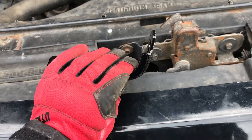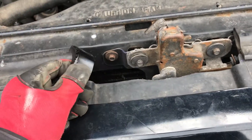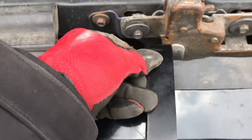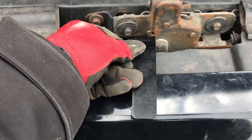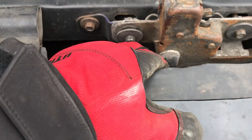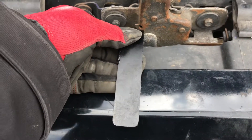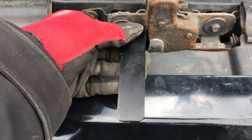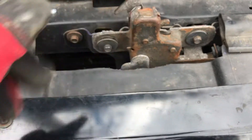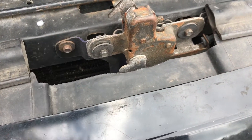So I've decided to try out this hood latch release. At the moment I don't know if it's going to work, but hey, just a couple of holes — if I don't like it I can take it off. But the gist of it is that you mount it like so, drill some holes through your latch right here, put your bolts in, and it allows you to relocate to this location. By some leverage upwards or to the side you should be able to release the secondary latch.